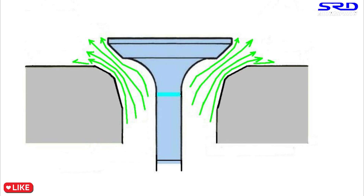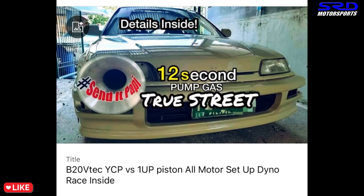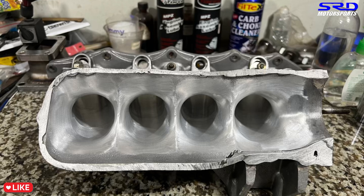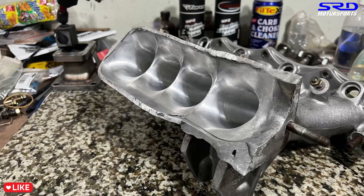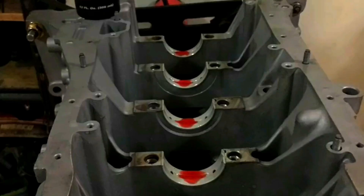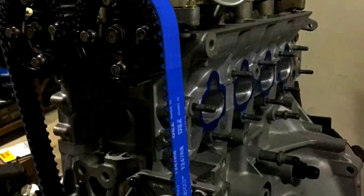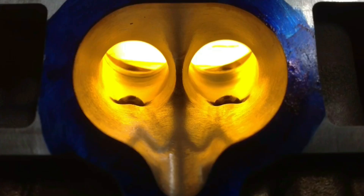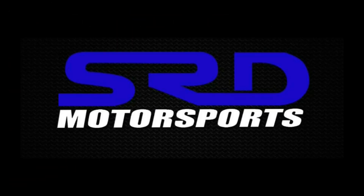That's the story with Jasper's B20 VTEC build — I'm open to sharing the setup and parts we use, because hey, that's just the parts. The assembly and all the details like this make a big difference. That's why this B16A with just ITR cams made over 210 brake horsepower — 186 wheel horsepower — because I focused on low lift and mid-lift. Of course the head is ported well, and on the manifold I tried to maximize the high-lift flow benefit. More technical stuff like this is in the playlist — you can just click it here.